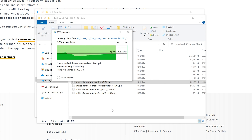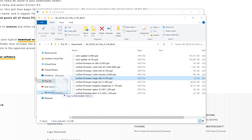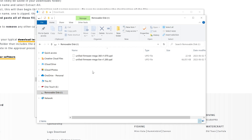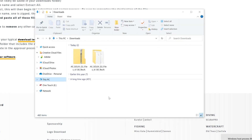We're going to find the Mega360 1.07 update and we're also going to drag and drop that onto the SD card. We'll open up our SD card and make sure we have the right updates in there. Now we are going to head back out to the boat and finish off our installs for the MegaLive and the Mega360.